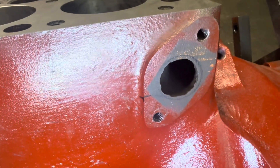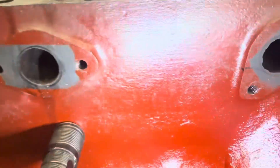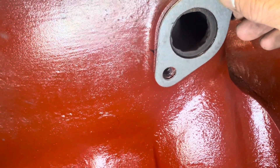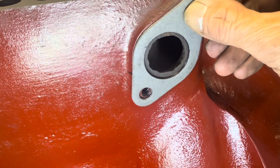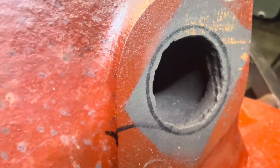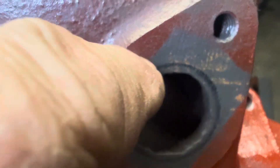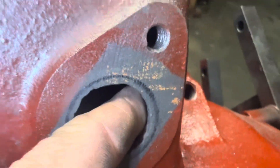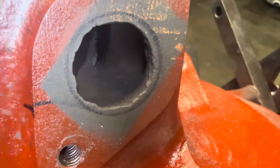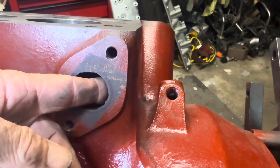I think I'm done with the ports. Here are the exhaust ports - this engine had very small ports in general. I'm sure these are only made for the flathead Ford and must be that size. I hogged out all the other sides and it seems fine. You can open these up significantly. Like the flathead Ford, there's a little corner right there that you have to grind out, then have this radius come out this way and gasket match. Just cut it to the line at that angle. I really doubt there's a water jacket in there given the geometry, so I think you can really open this up to the corner - but anything's possible, so be careful.